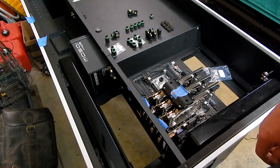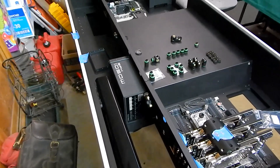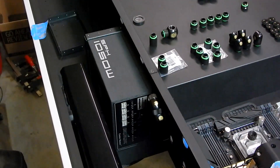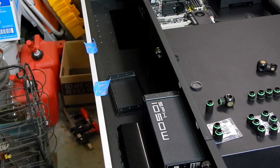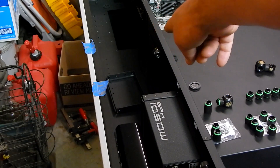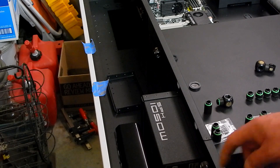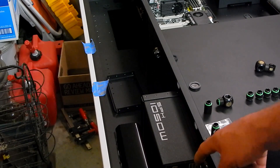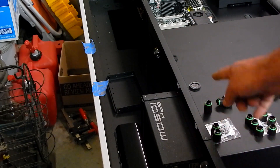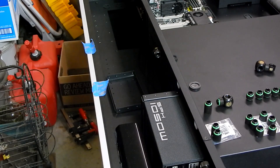All right, moving on. We're at a point of no return now. I've got all the tubes except for the one that's going to go over the power supply. There's a fitting here and another fitting at the other end — that'll be the pump feed out. The pump will most likely be in the corner over there. The tube will come across the top and drop into the CPU. I have a 45 and a 90 attached to give me just that little bit of rise above the power supply. I'll have one more tube to bend that goes to the top section of the radiator.